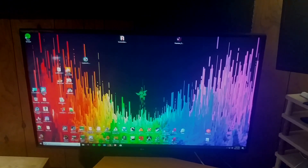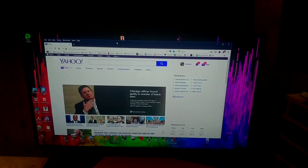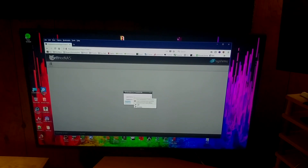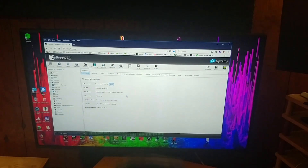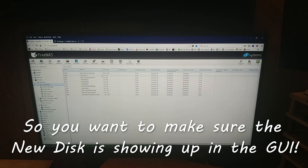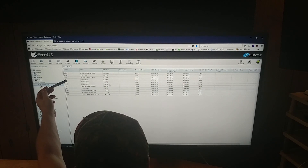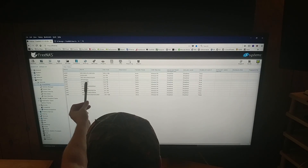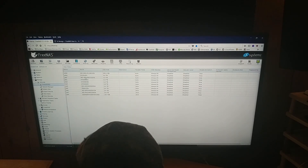Back at the main PC now, let's navigate to the FreeNAS interface. Under volumes, I'll go to View Disks. Da1 and da2 are my two 2-terabytes that I want to resilver. I'll take the last four characters of the serial numbers, making sure they don't match anything close. I write them down — da1: echo delta zulu charlie, 2 terabyte — on a notepad.